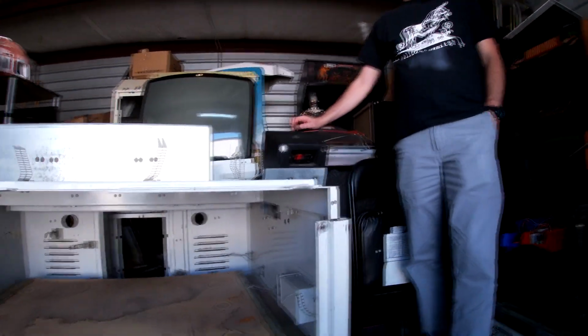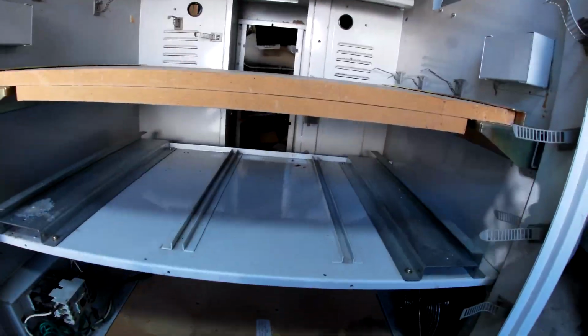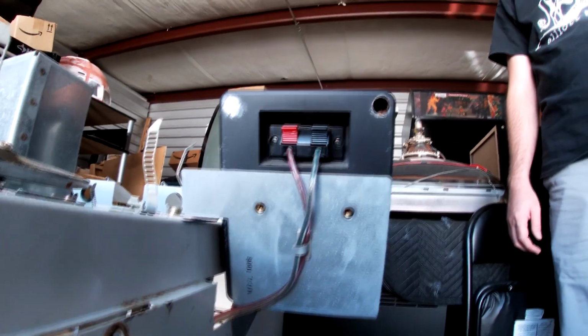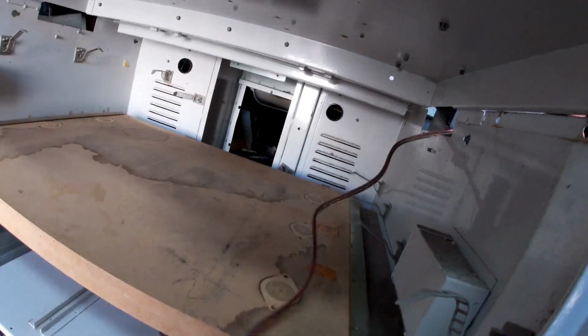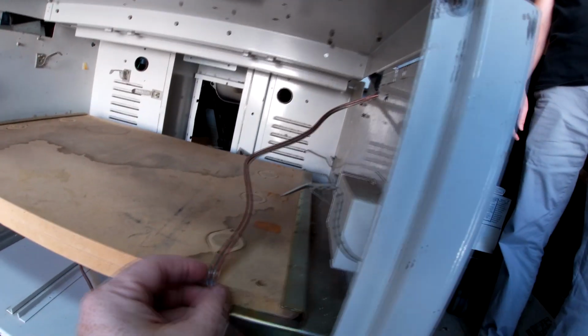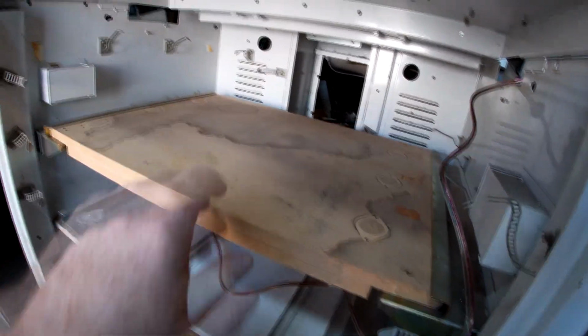We have our speaker, so I'm just going to go ahead and cut some speaker wire, run it through the bottom here, and feel around where we want to have everything mounted on the inside of this. All right, so here is basically how the speakers are going to be run. So we have them mounted here, and again, we'll put those other 2 screws in to hold them, but for now, they're fine. We have the little harness there, and it comes through the cab, comes down here, and then we're going to have the sound amp and everything sitting down here. So we'll have enough speaker wire to do that. So we're going to get the other side run, and then before we leave, we'll pull this out so we can take it home and sand all the grossness off of it.